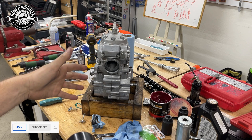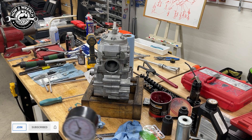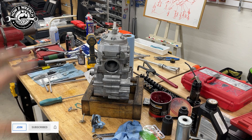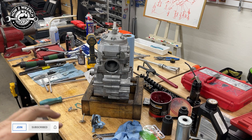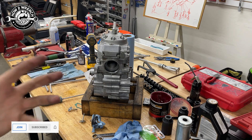You get ready to put this in your motorcycle and you're going to know it's ready and good to go with no problems. So if EJ continues to have this spark plug fouling issue, he's going to be able to really know — hey, I've got to chase a fuel issue or an ignition issue, something else that would be creating an incomplete burn.